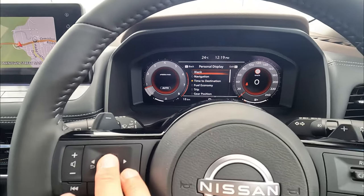Next we have parking aid — your parking sensors will pick up moving objects. You can see the display — the parking sensor will display the lines once your camera is on and will pick up landmarks in front or behind. We have front sensor and rear sensor. You can allow the parking sensor to engage at medium, far, or close distance level. Volume can be changed to low or high. Next is the rear cross traffic alert — when you reverse out of a car park and someone is crossing behind you, the vehicle will give you a warning flash on the mirror. It doesn't give you a full stop, but will give you a warning in case you are reversing too fast.